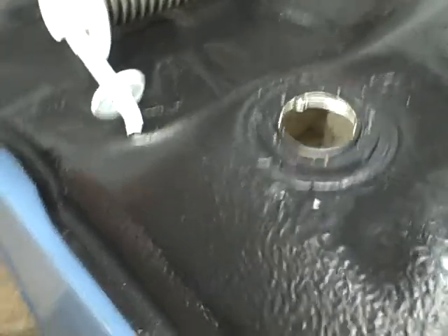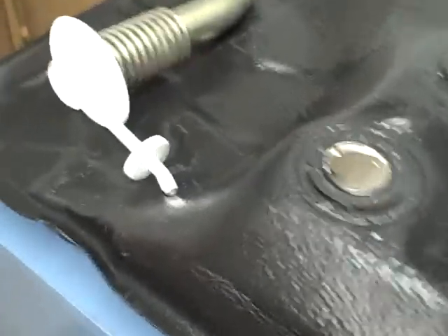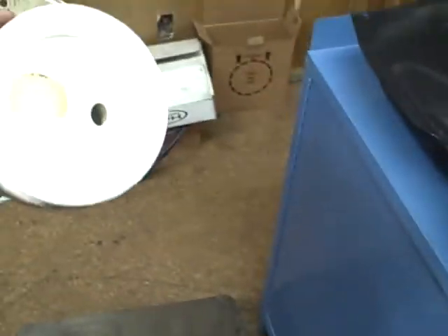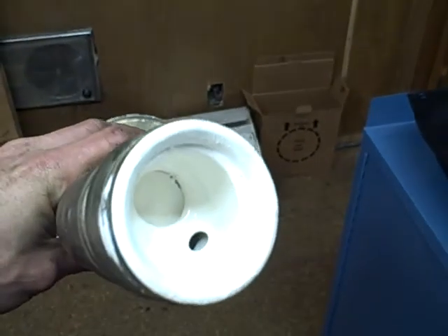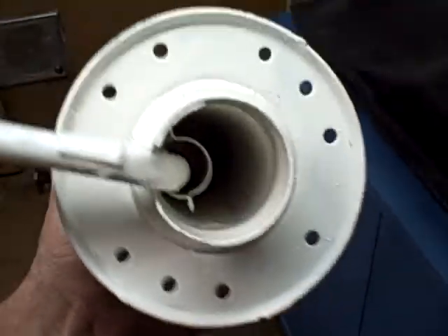This is a very good upgrade if you're gonna rebuild your Corolla AE86 — I really recommend checking your gas tank. You can usually tell when the filler necks are also starting to rust out. This one was also epoxied on the inside, as there was rust in the filler neck too. So now we're gonna have good clean fuel going to our 4AG motor.